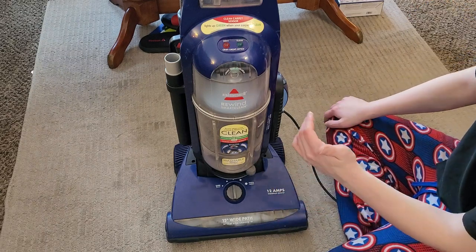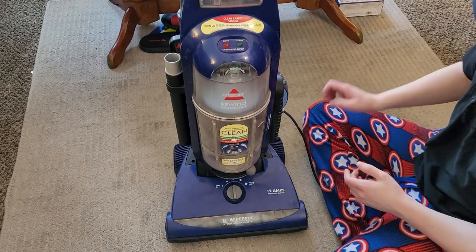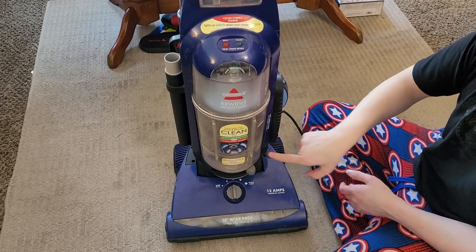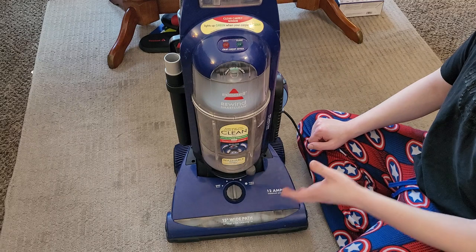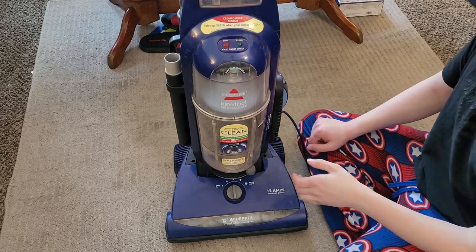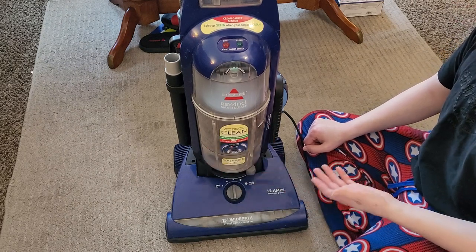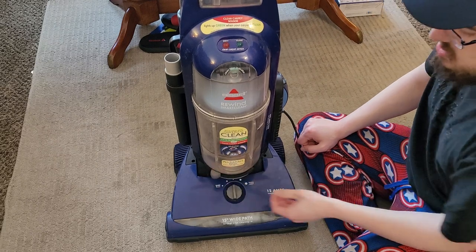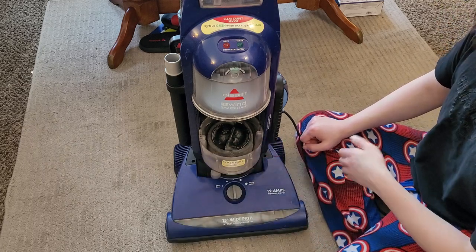There's no cyclone anywhere in this machine. Bissell advertises their Helix system — just little ribs on the side of the dust cup that try to emulate a cyclone, but it's not a proper cyclone. All the dirt is essentially sucked past the separator, meaning a lot of fine dust immediately goes through into the inner and outer circular filter. On previous Bissell PowerTrack Revolution machines, side channels effectively separated dust, but Bissell got rid of that. What Bissell did instead now is when you twist the lever and pull out the dust cup, the filter stays on the machine so you can clearly see and clean or replace it.